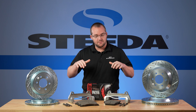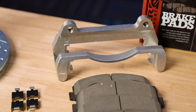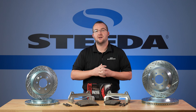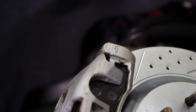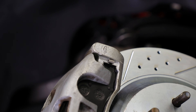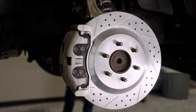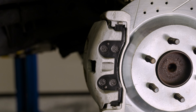One of my favorite parts about this kit is the brackets that are included. This replaces the factory caliper bracket on your F-150 and allows you to run a much larger rotor up front. The Bear rotor provides a larger braking surface area, which means better cooling when you're towing or racing. And unlike many other kits out there, this actually replaces the caliper bracket — not an adapter, which can be a little sketchy if not installed or manufactured correctly. This eliminates all of that by replacing the factory caliper bracket with a Bear piece.